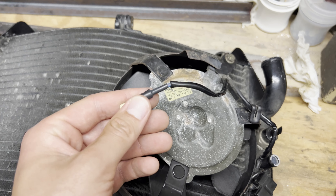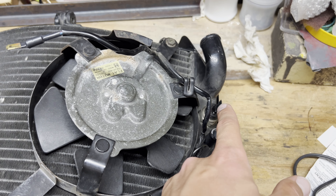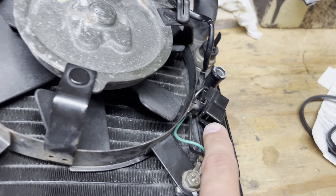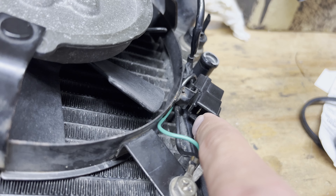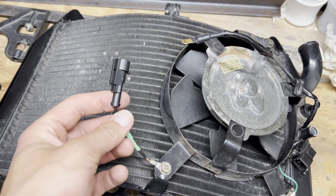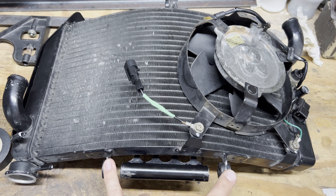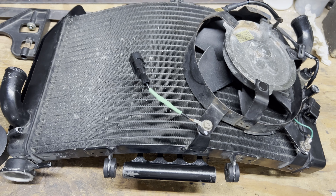For the fan setup, the one thing I changed was taking the OEM fan and putting it on a switch instead of running it on the temp sensor. So I have my R6 fan on the switch and the OEM fan on the switch. All you do is take the blue power wire that was in this plug and run it directly to your switch panel - the temp sensor is no longer hooked up, just taped off. I used the same spade connector that was on this wire and ran a green wire to the frame as my ground. This plug now just has a single pin for the ground from the wiring harness. When you plug the harness back in, that black wire grounds out the fan. I put a quick connect on the R6 fan ground so I can just unplug it easily. Now we have two fans on a switch, new radiator, better lineup, better fitment, and two bolts instead of just hooking on one side.